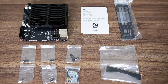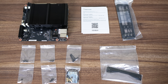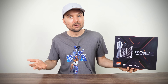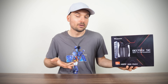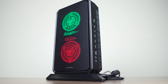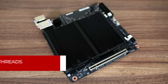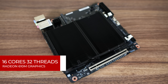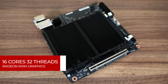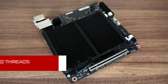An M.2 wireless card and antennas are also required if you want Wi-Fi and Bluetooth. The board features a powerful AMD Ryzen 7945HX mobile CPU embedded on the motherboard. We've already seen it featured in the Mini's Forum G7PT gaming mini PC, and it's an impressive 16-core, 32-thread processor with more CPU performance than your typical flagship found in an AMD-featured mini PC. It's not upgradable or replaceable.